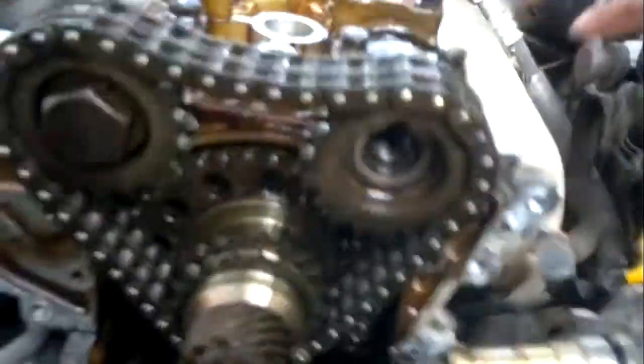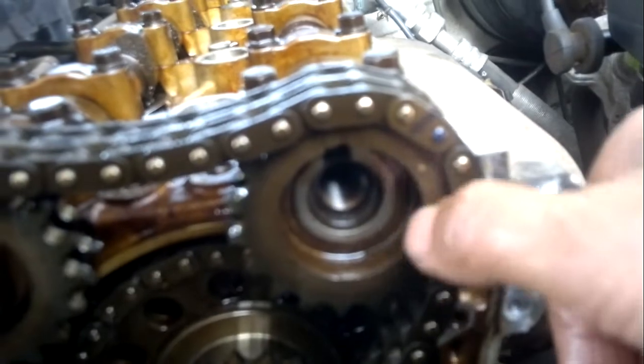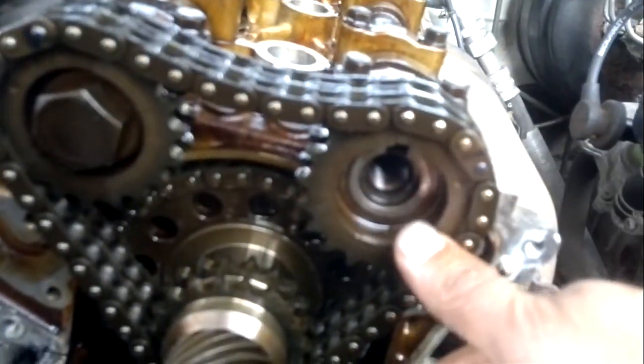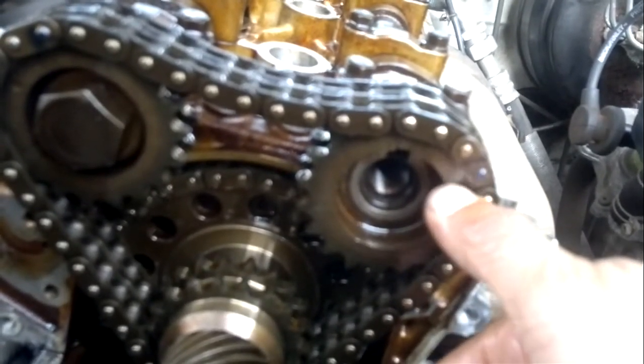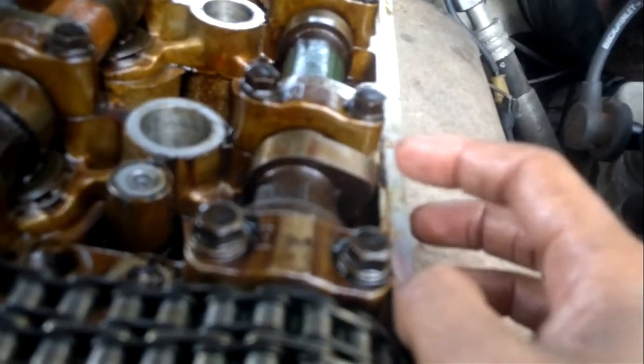The way I realized that is these timing marks would match up where I left them off at — I left them off at top dead center. So right around there, I marked them. The timing mark was coming off to the four o'clock position, so I knew something was off because my cam lobe was pointing in the same direction I left it in.